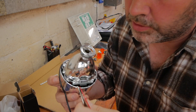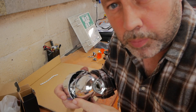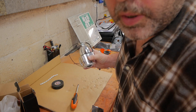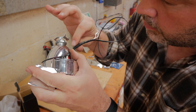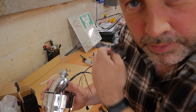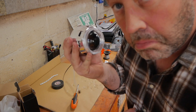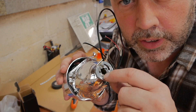Right, what I'll do now is tidy up these cables a little bit because I want them coming out the bottom through the side light bulb holder. So I'll tape these up together and just make them look a bit tidier. What I did on the last one was route the cable to come out about halfway then out of the side light holder. To cover up any colored cables - because they reflect in the reflector of the original lamp - I just used a bit of silver tape to stick over them, which stops any reflections of colored cables.